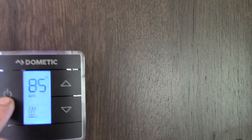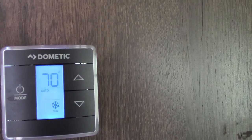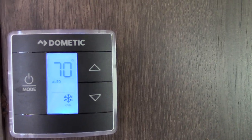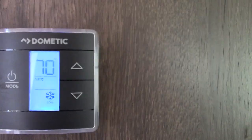This trailer has to be winterized and you have to bypass the water heater before you pump antifreeze into the system — make sure you educate yourself about that. This is your thermostat — very simple. Push the mode button to light it up and then you go from cool, furnace, off, fan, and back to air conditioner. Try to keep everything on auto. When it says fan, the fan is just the air conditioner running without the compressor — it just circulates air. There's a lag time every time you choose a setting; if you turn on the AC, there could be up to a six-second lag. That's perfectly normal.